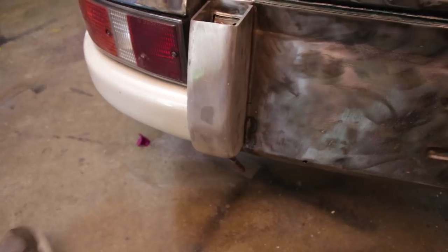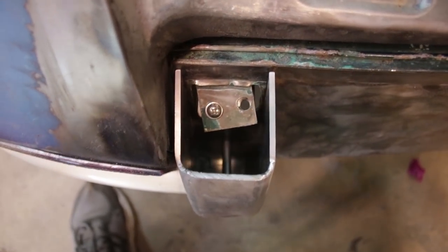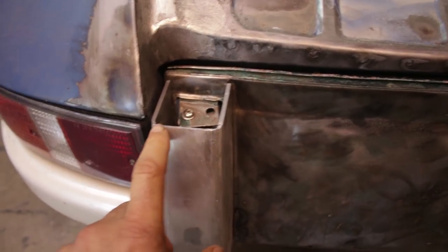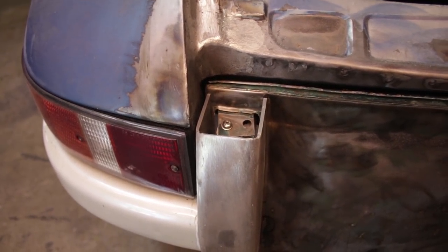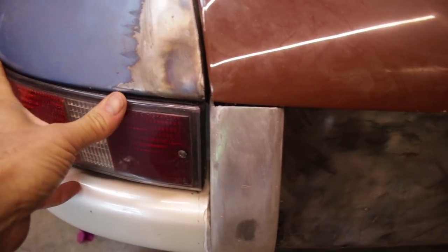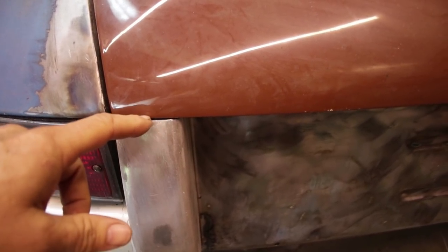This bumperette is now attached to the car. Trying to get a view for how it's lined up. If you look down inside here, there is the stud. I did drill a hole in the license plate panel for that to attach, and there's a nut on the back side. It covers up this tab where the license plate panel attaches. I'm just getting ready to do the final trim on the top so that it matches the deck lid with the correct gap. Closing the deck lid - it's a little bit tight right here and we want to go probably a little larger than this gap, which is usually about three or four millimeters. I want to create maybe a five millimeter gap across the top, and I need to weld the plate onto it, which is going to add some thickness too.